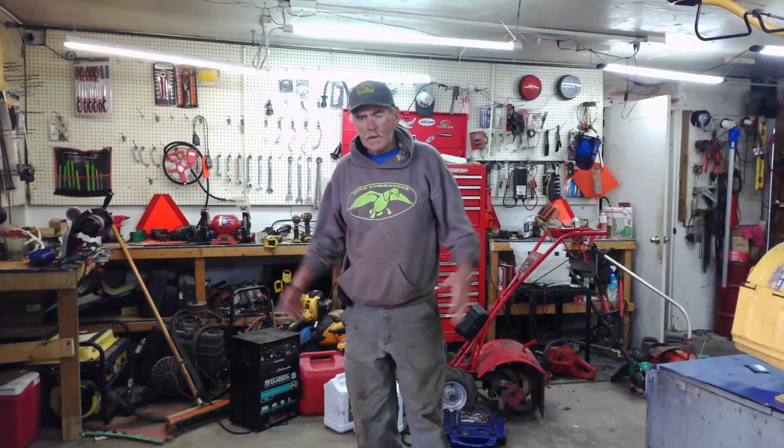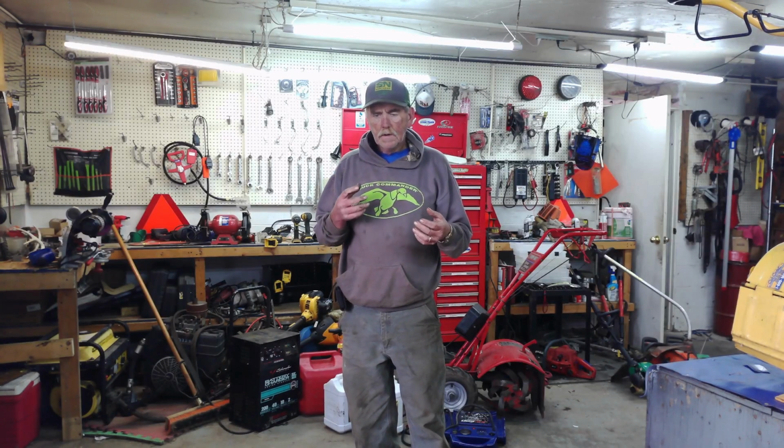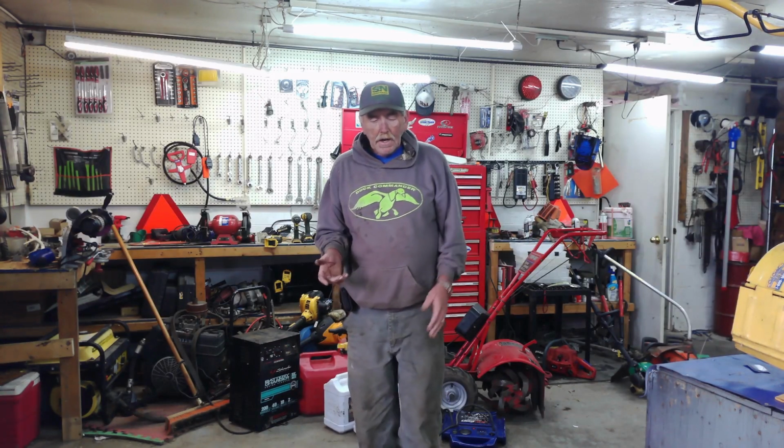My name is Eric. So what I thought we'd do today is we've got a Cub Cadet Zero Turn, and I've done a video on trying to find the issues earlier in the week. And we found out that one of the coils was weak, and we ended up ordering two brand new coils. And why two brand new coils if only one is a problem? Because it never fails. If one is getting weak, good chances are the other's right there. And for what they cost, you're already in there to go ahead and put them on.